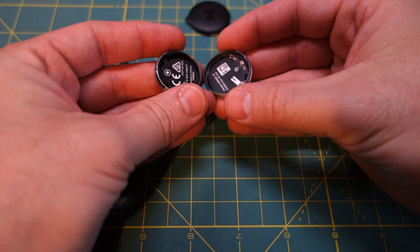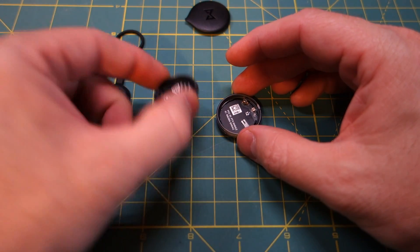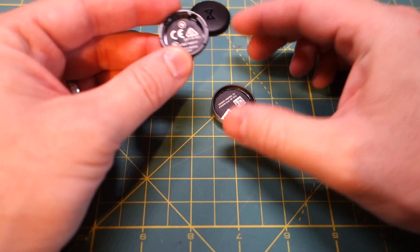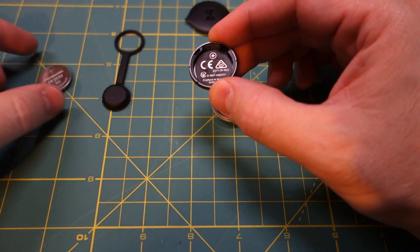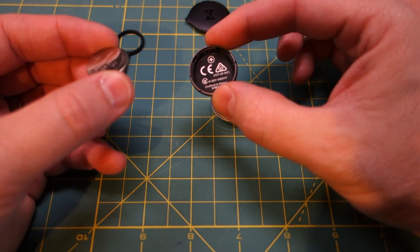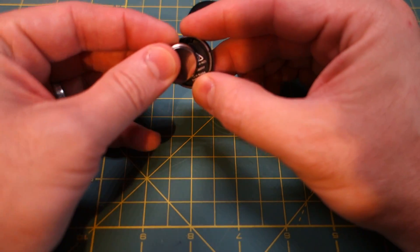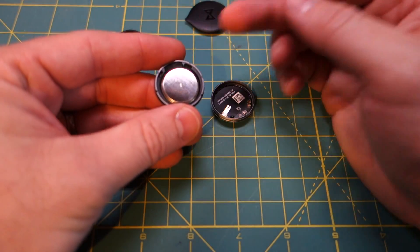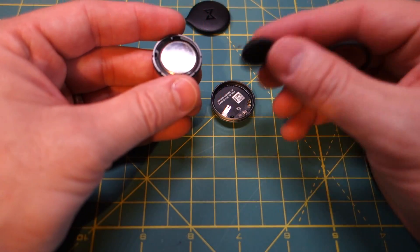Opening the Shine, there's really not a whole lot inside that you can see. There's a place for the battery to go, and the back of the Shine has a little plus symbol — this is where you'd actually put the battery, with the plus side down. There is a magnet in here, so the battery will stick. You put it in and you can see it clips right to it. That's how you install the battery — it will stick to the inside when you put the case back on, so it won't fall out.